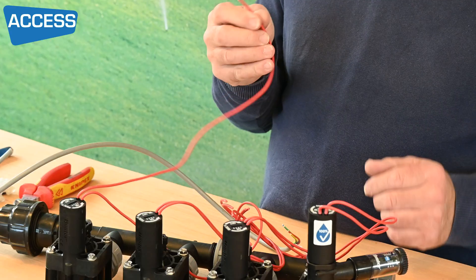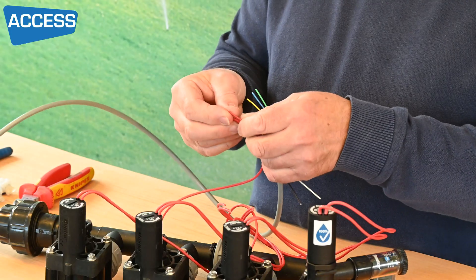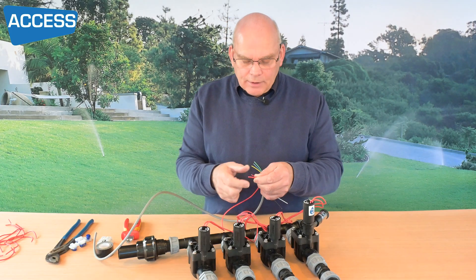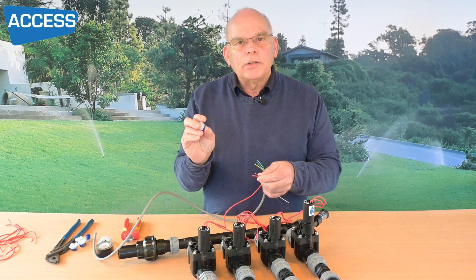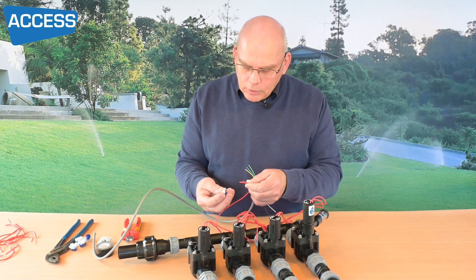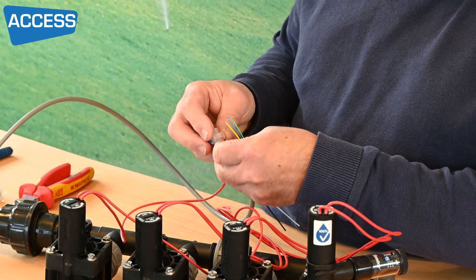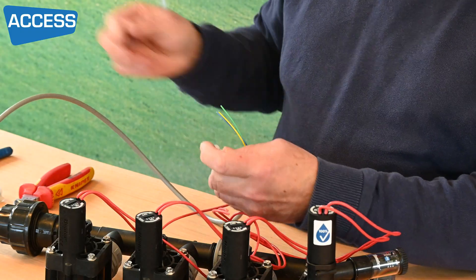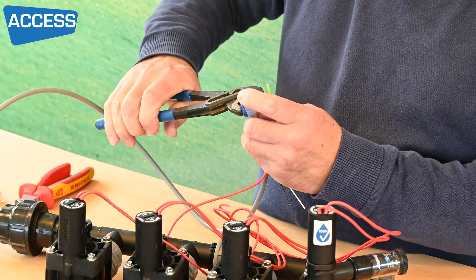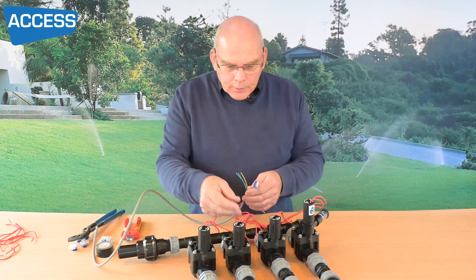Let's do the trigger wires first. I'm going to use red for number one, so I'll take one wire from my cable and use a grease crimp connector. The beauty of a grease crimp connector is I don't have to bare any wires and it seals them — there's silicon grease inside so when it's crushed down it seals straight away. Feed the wires in and check they've gone fully in at the back. Always use a pair of grips to tighten them up, make sure it's sealed well down, and give it a tug to make sure. That's number one.